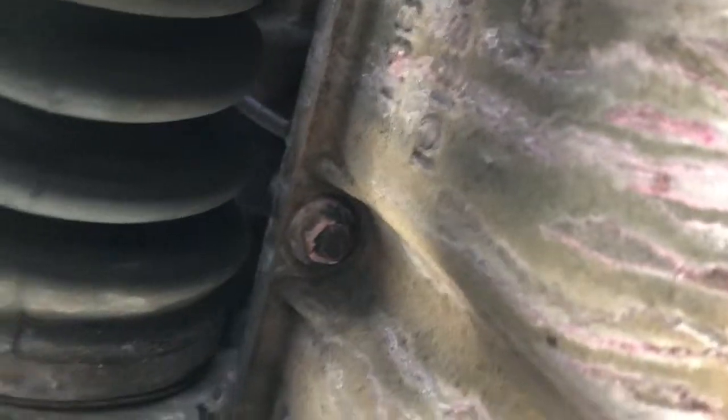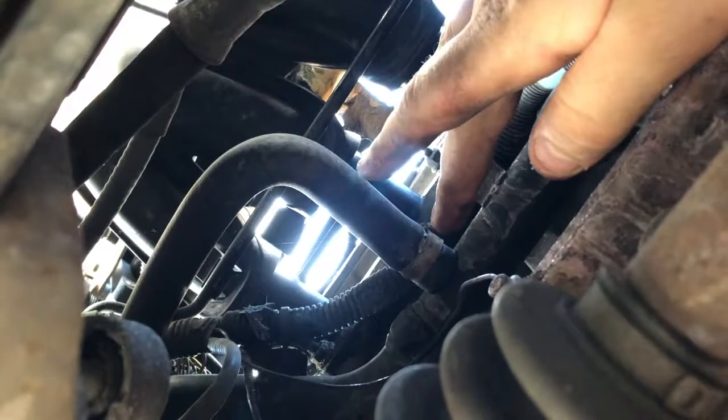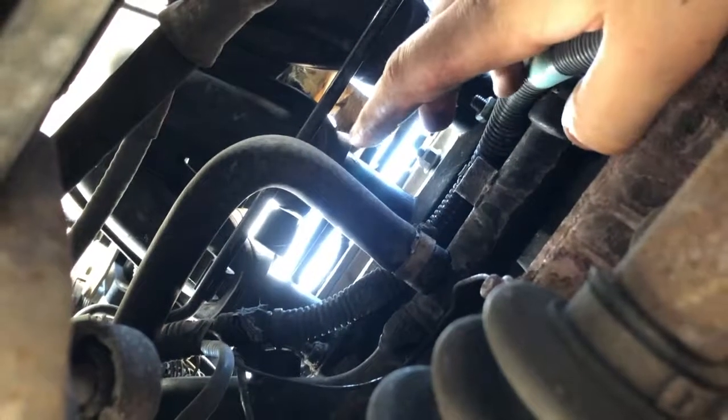The reason why I'm going to drain it out, and how zoomed in this camera is, let's get further back. Basically, you can see there's pink stains on the bottom of the engine, which is coolant. So I've seen where it's dripping from. I followed it up and basically, get my hand up, there's this pipe here, you can see it there. I don't think that's connected right, and then this pipe at the top looks like it's got water on. So I don't know if it's come out of there and sprayed up or it's this pipe. So what I'm going to do is drain all the coolant out, take that hose clamp off anyway, and remove this, and have a look and see if this is damaged. If it's got a split in it, I'll fix that.